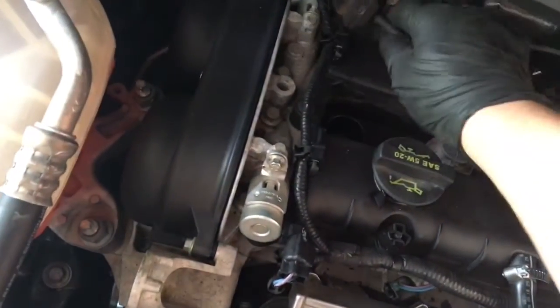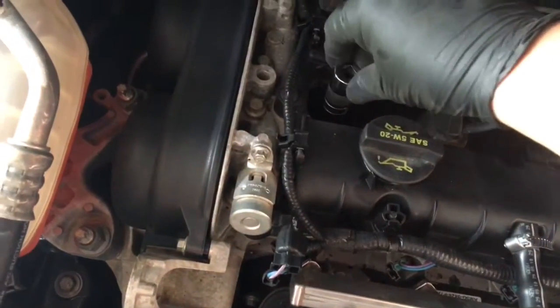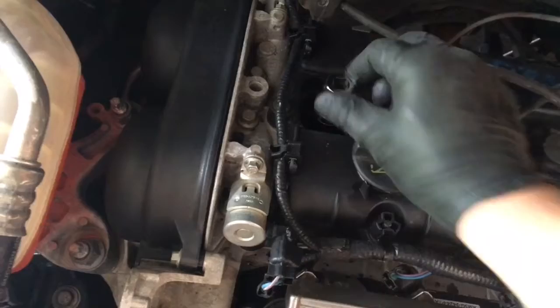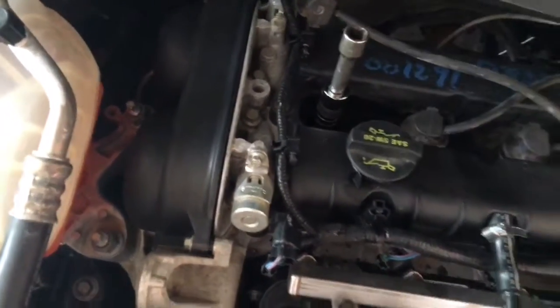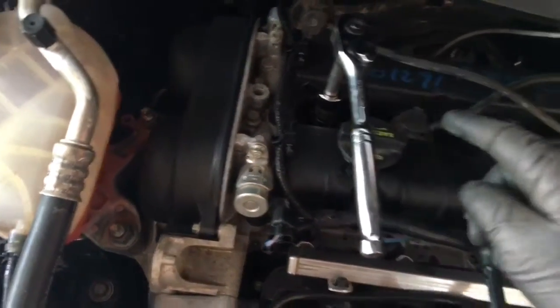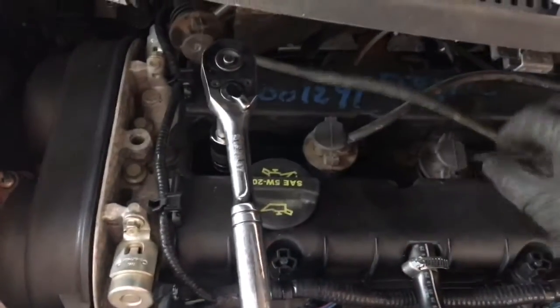And so I'm going to take off the first spark plug wire, and then just hang it there. Put in my socket. You're going to turn it until you feel it dip down a little. There it goes. Push it in all the way. Put the extension on, and now I can unscrew it. And I'm going to do one at a time like that, removing